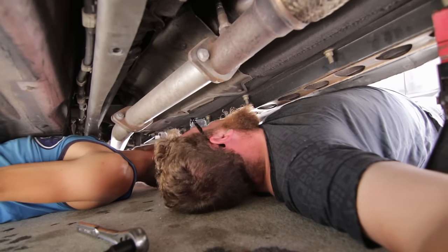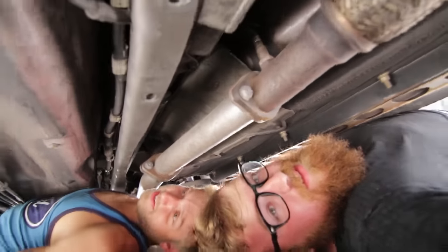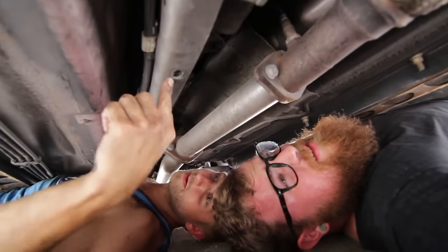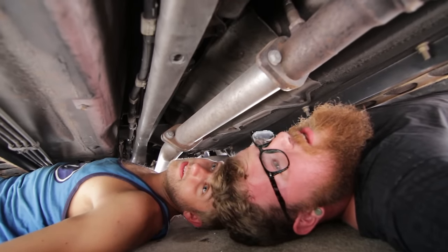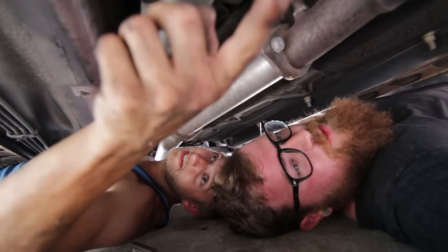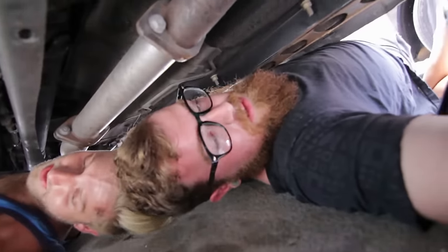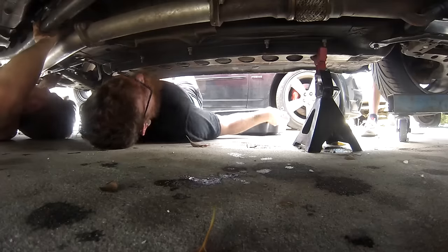Where are we at, John? Well, the drive shaft's almost out. We just gotta move the car so we can get the last bolt, and then we're gonna do the speedo cable and this power frame dealy do here and engine bolts. No, power frame's done. Power frame's done? Yeah. Then like engine mounts, which are almost done, and slave cylinder. And then like double check to make sure nothing else is connected. This is coming out. Where could the chain to pull the motor be?